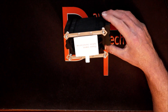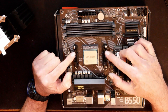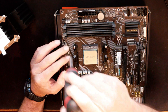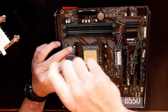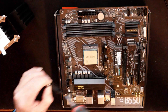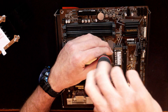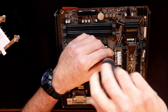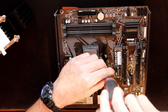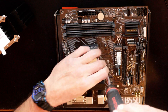Now we need to get our motherboard. If you're building brand new and you don't already have a heatsink on your system, you're going to have these brackets you'll have to remove, because this heatsink screws right down into the backplate that comes with AM4. You need to remove these, or remove your stock heatsink if you're replacing it. Just take the screws out and remove the plastic bracket. I would suggest keeping hold of these brackets because you never know — if you need to upgrade or go with an AIO down the line, you may need them again.